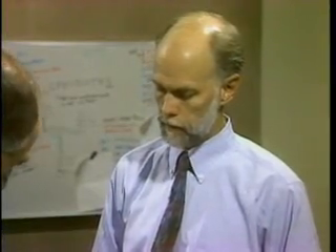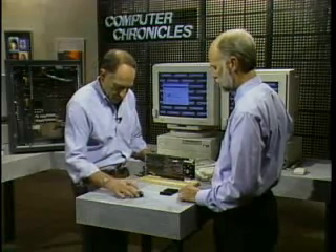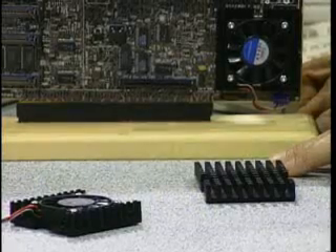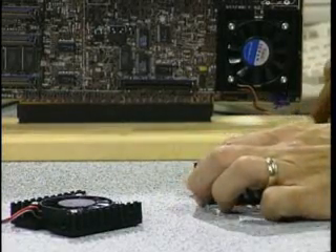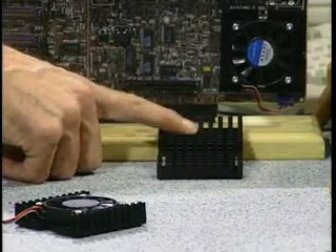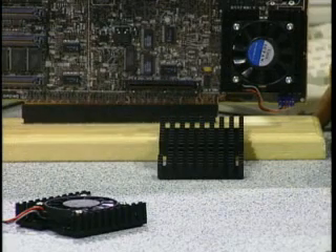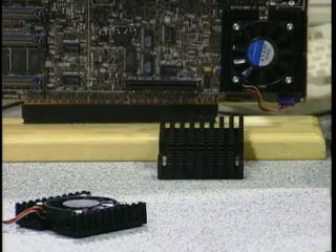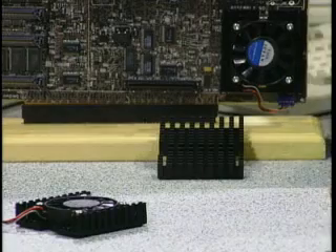Let me ask you about the heat question again. You showed me the fan sitting in front of the Pentium and you've got these cooling devices here. What are you doing with these things? What we have are the 560 Pentium and the 566. On the 560, we can cool it very adequately by using a passive heat sink. So the 60 megahertz chip uses a passive heat sink. When we designed the DeskPro M back in 1990 and early '91, we knew that it would have a Pentium in it and designed it for that, with airflow coming around the outside of the computer. When the 66 megahertz — we actually go ahead and put the extra fan, just for that extra margin of safety.